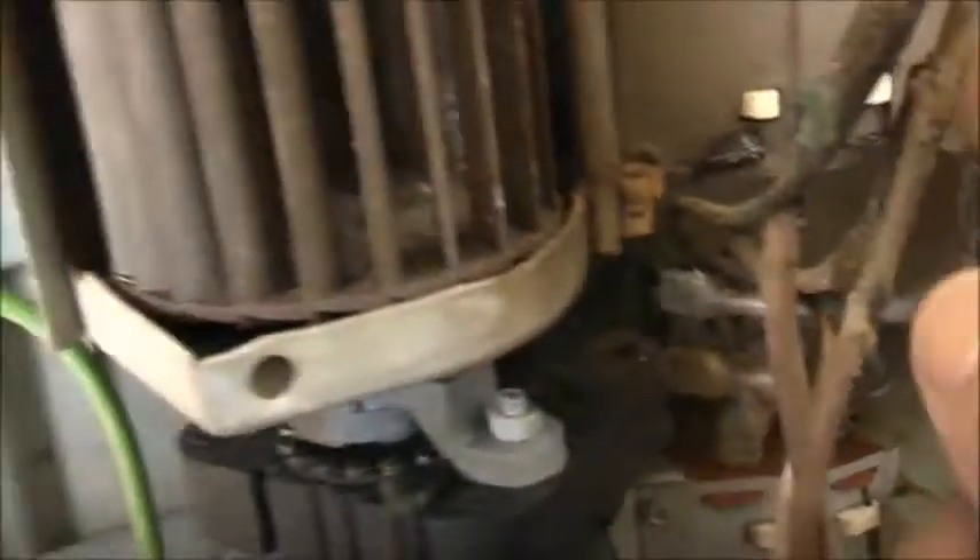Let's see if we can get this thing going again. No bimetallic strip, so we'll have to fix that. It's been smashed off. I'm not sure what caused that - there may be some high resistance, and that's probably what caused it to melt up in the first place. The main power wire is overloaded. Something's gone high resistance in here - it's melted those connectors over there, melted those down. Those wires don't appear to be overloaded, just these ones got burnt. One of these heating elements has gone high resistance, I reckon, because these heating elements are clean. Something's gone high resistance - the heating element's gone high resistance and these fans are seized up.